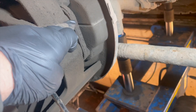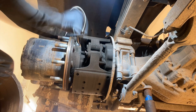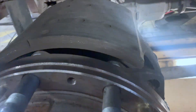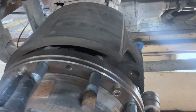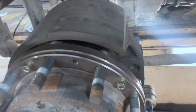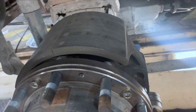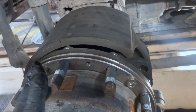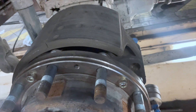This bolt out here — we're going to have to take the back plates out because that pin will not come out far enough. There's a 17mm bolt that comes out of this little bracket, it's like a little plate. Take that out, you have to take all the back plate out, which are E-sockets, and then knock these pins through. My forearms are killing me, but we're off, so now technically we should just be able to knock them off. Getting them pins out was a bit of a pain, so let's get these shoes off.